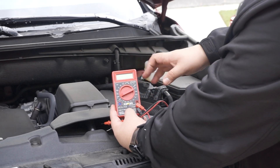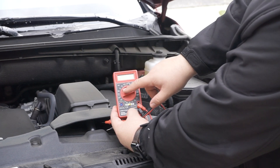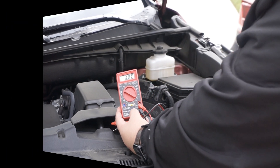Using an inexpensive voltmeter just like you can see here, you want to go to volts DC. Since it is a car battery we'd want to select 20 volts, then power on the voltmeter, make sure that it's zeroed out, and then we'll go ahead and test the battery.